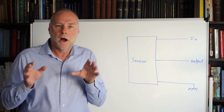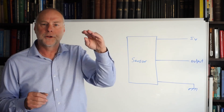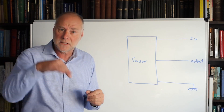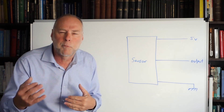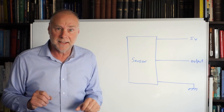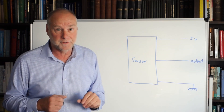In the previous video, I showed how you could add a little voltage on top of the existing signal, or you could take away a little voltage from the existing signal. The signal would still go up and down with whatever parameter was being measured, but we'd get a proportional increase or proportional decrease. That changes what the ECU sees, the ECU changes its behaviour, and we can achieve our modification outcome.